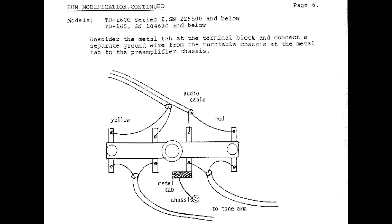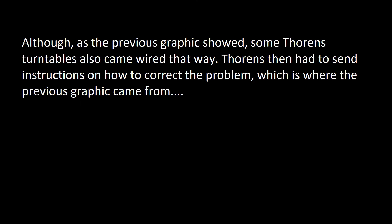Now someone out there is probably raising their hand asking: why is it that some turntables don't use a ground wire? That's true — some turntables simply don't have a ground wire, because they've been wired internally to send the ground down the audio cable like everything else does. It's a compromise, and you usually see it in DJ turntables where they're not looking for super high fidelity or super low noise — they're looking for something they can hook up and disconnect quickly at the beginning and end of a gig. This is not something that should be done with a high-fidelity turntable, because it will increase hum pickup and noise pickup.